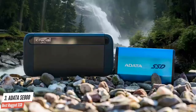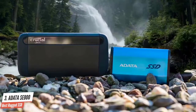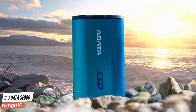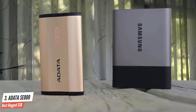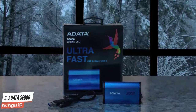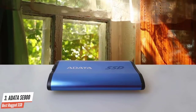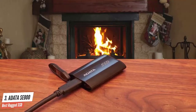In fact, it's one of the best portable SSDs you can buy. At 72.7x44x12.2mm and weighing only 40 grams excluding the cable, it has a smaller footprint than the Samsung T3 and T5 and is lighter as well, though slightly thicker — probably due to the extra protection needed to earn its IP68 certification. ADATA claims read and write speeds of up to 10Gbps via a USB 3.2 Gen 2 connector — not to be confused with USB 3.2 Gen 2x2, which reaches up to 20Gbps in theory. The SE800 features strong large-file transfer performance, dramatically outperforming the Crucial X8 in 120GB+ transfers, and even writes faster than the much more expensive Samsung T7 Touch.